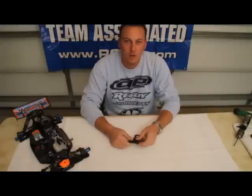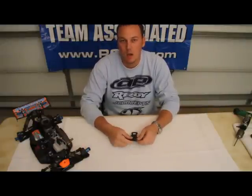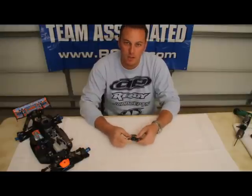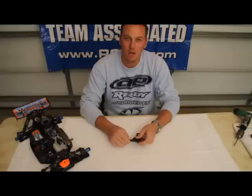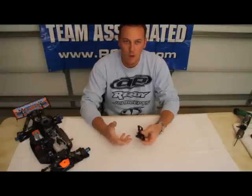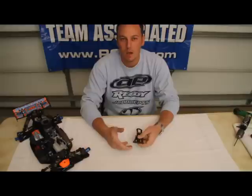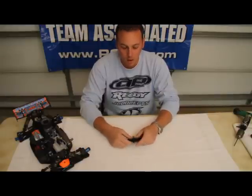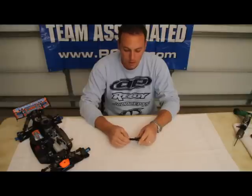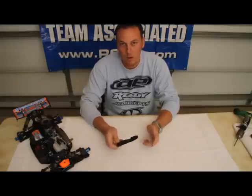All right, in this first video, what we're going to talk about are really the basic suspension components, the linkages, and the radio tray setup. And what I'm going to start with is basically focusing on getting the suspension as free as possible. A suspension that binds up or a suspension that doesn't flow freely can greatly depreciate the handling of the race car. So the first thing I'm going to start with is the relationship between the A-arms and the hinge pins.